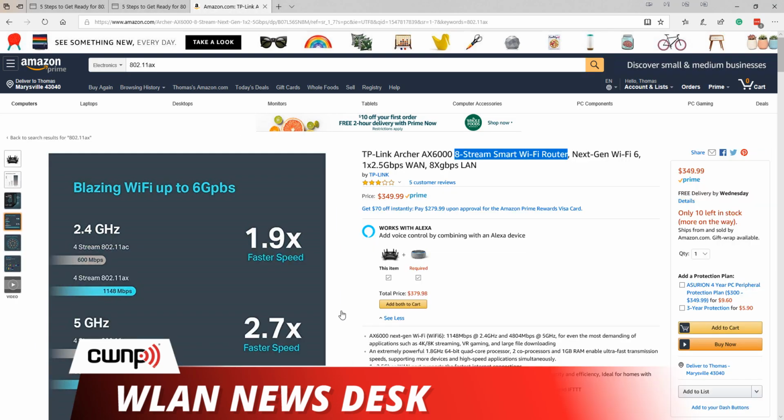So that's actual 802.11ax stuff. When we talk about the efficiency features that 802.11ax brings, we're really talking about using resource units, which is down the road because we need 11ax clients. There's news out that the iPhone that's released later in 2019 may very well support 802.11ax. That's fine. Right now, we don't have it. So even if I did implement some of these enterprise 11ax APs that are coming out, I'm not immediately going to reap the rewards of it. All my clients are 11AC, and at this point, I'm going to get 11AC connections to those APs. Once I have the capability to connect AX clients, though, I can begin to get that benefit.